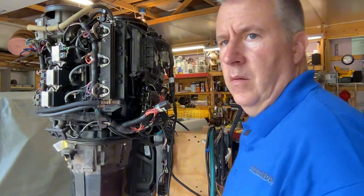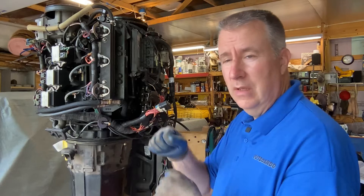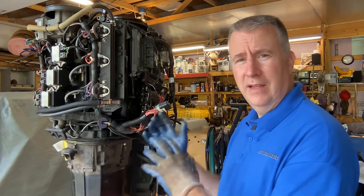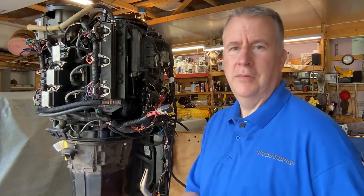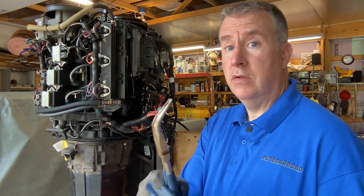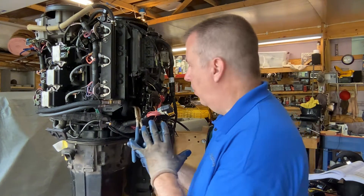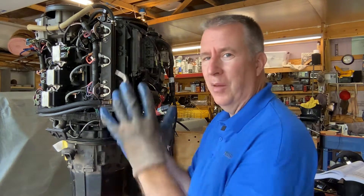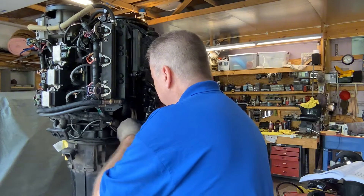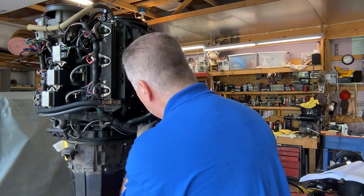Nice clean bolts. I'm gonna go ahead and disconnect that tie strap and get that hose off first before I take the last bolts out — it may be harder to do it when it's all loose. I want to see how the poppet valve spring all goes in together so I remember. Sometimes it's good to have a set of needle nose to get into tight places. This one has some corrosion — I see a fish scale. The hose is still painted from the factory, so this has never been removed, because as soon as I squeeze that hose and start to pull it off, all that paint cracks right off the rubber.